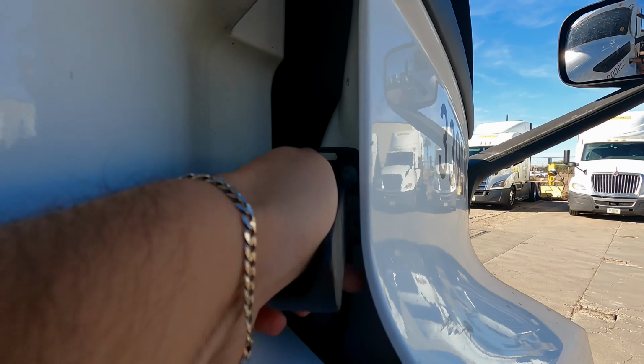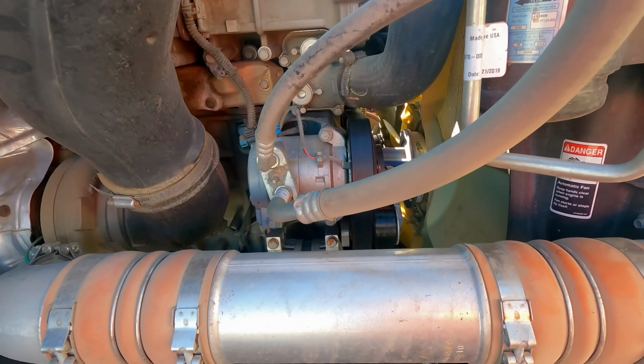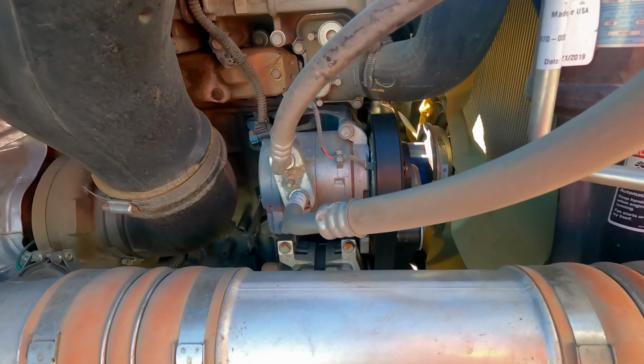Now that we popped the hood, we're looking for the overall condition in the right side of the engine compartment. Note, make sure to practice and learn where each of the components are located on the vehicle you are testing, as they can be in different locations depending on the manufacturer. You want to check all the hoses for leaks and for proper condition. Check all wires for proper condition and make sure they're fastened properly. This would be a good opportunity to check the ground for any leaks or puddles and locate where it's coming from. You want to check the alternator is properly mounted and secured. The wires are also securely mounted. It is belt driven. The belt is not frayed, torn, or cracked, and has no more than 3/4 inch of play.